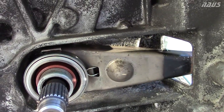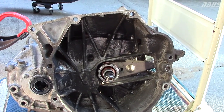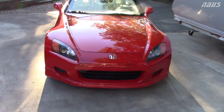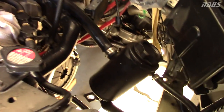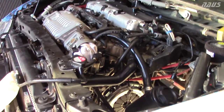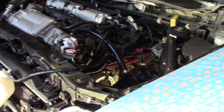After this step, once you get your boot in, you can go ahead and start putting it into the car. Really the only thing you have to do is grease up those components with fresh grease so your clutch pedal feel is really smooth when you put this back together. That's what makes the difference — taking your time and making sure all that stuff is lubricated. If you want to learn how to put it back in the car, go to my channel and watch the video of me taking everything apart and just do everything in reverse. Use your engine hoist, or bench press it in if you're strong enough. Lock your eight bolts around the casing, put your axles in, work on your subframe — basically just reverse what we did in the transmission removal video.